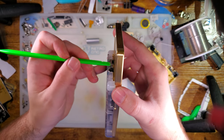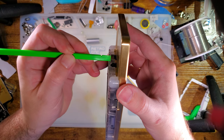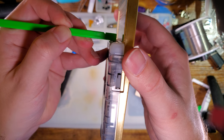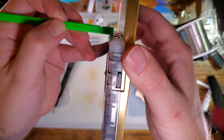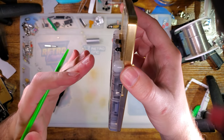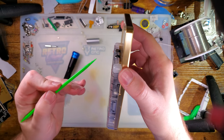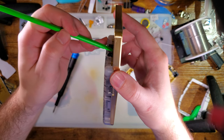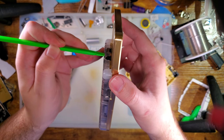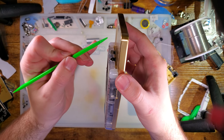And what that means is the walls on the plastic are not perfectly straight. So you can see as I slide my spudger up and down, there's just a hair gap between the back of the spudger and the shell, as the shell curves out like this. Of course, I'm exaggerating, but it curves out like that. I didn't match that draft angle with my shells. I matched the top of the shell, which means that the shell is going to curve out above the slate